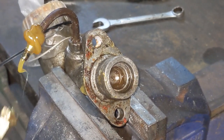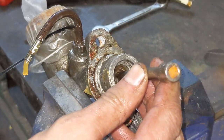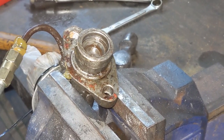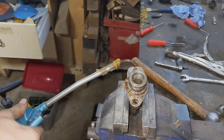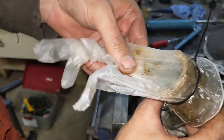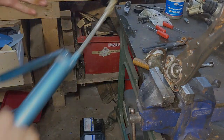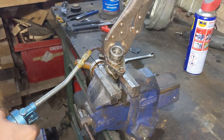I had plenty of grease so I didn't mind using a bunch if that's what it took. I spent probably the best part of an hour pumping grease in there and tapping the piston back down, and little by little it got easier and easier to move. Eventually though the inevitable happened — whatever was blocking the reservoir freed up and all the grease suddenly started going in there. No big deal, I just stuffed some paper towel in there and put the cap back on — where it immediately leaked through. So I sealed it up, put the cap back on again, and this time it forced the cap right off.